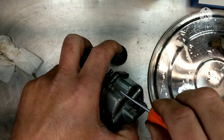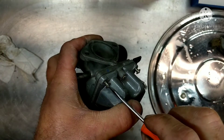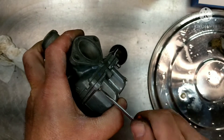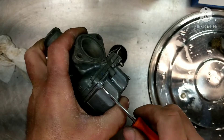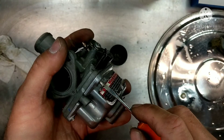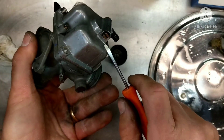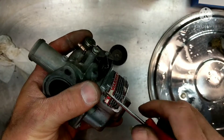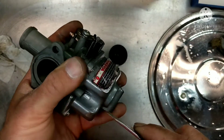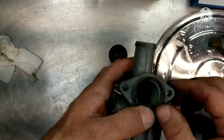This was a no-run. I've already changed the fuel — I dumped all the fuel out and there's fresh fuel in the tank. So the first thing you want to do when you get these is always dump the gasoline out of the carburetor. It's got a flat head screw at the bottom and you can just drain that out. A lot of times it's just the fuel that's in the bowl — the fuel will sit in the bowl and the vent lines will let it go bad quicker than what's in the tank. So just loosen this screw, dump the fuel out, turn your fresh fuel on, let it flow through a little bit and then you're golden, hopefully.